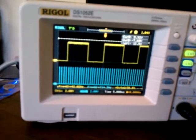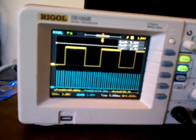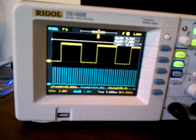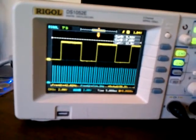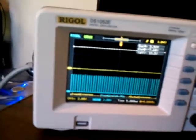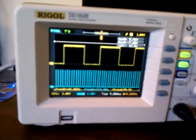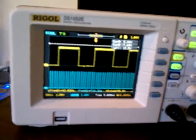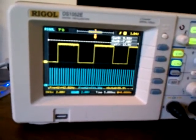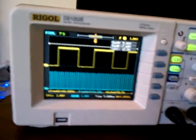We've got the duty cycle down to about 50% again. The other things we have are the torque converter clutch brake and torque converter clutch lock. The TCC brake is a switch that pretty much all 4T40Es use, which releases the torque converter on decel. If we press it, you'll see the torque converter clutch goes to zero; release it, goes back up. The TCC lock is something I added — someone on the board mentioned having trouble dynoing because they couldn't lock in third gear. This will allow you to lock any gear. In the final implementation it'll be a switch, but right now it's a momentary button. Press it, pulls 93%; release, it goes back to looking up the tables.